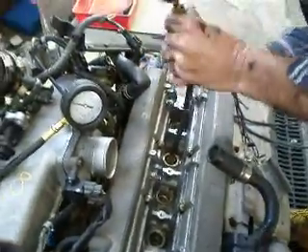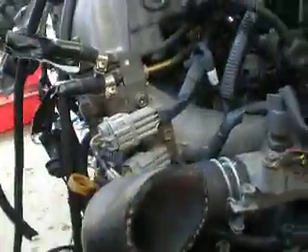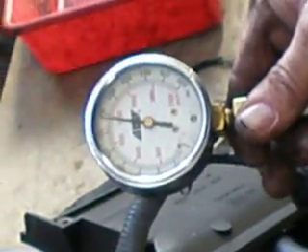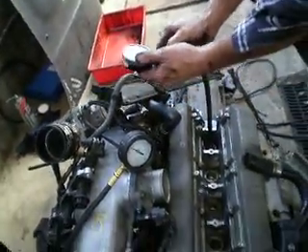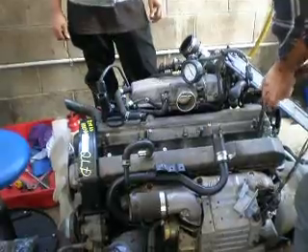So we've got the last cylinder coming up. While that's getting screwed in, we've just looked on this side of the motor — nice and clean. Radiator hoses are very clean, no build up or crackle or anything bad on the radiator. Cooling system is clean. Number 6 — 175 again. Oh, that's a very good motor, isn't it? You can tell it's only low mileage. At least we're all even. End of testing, thank you.